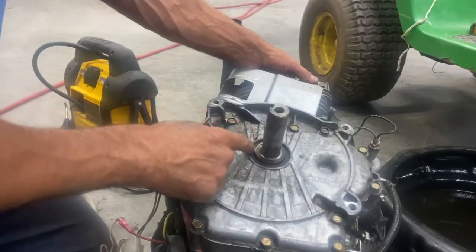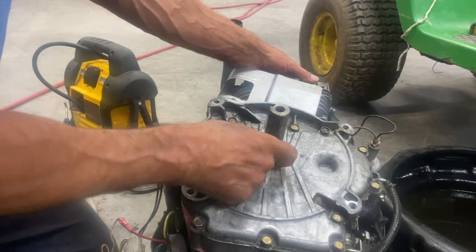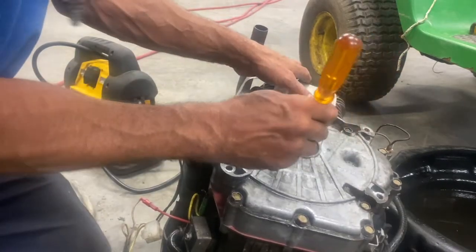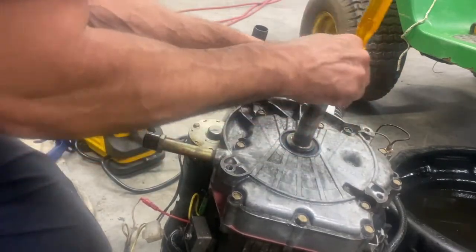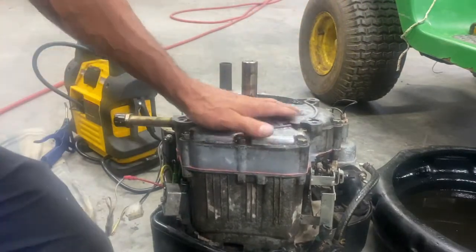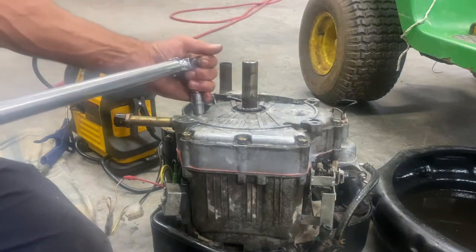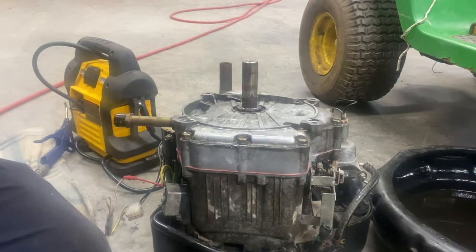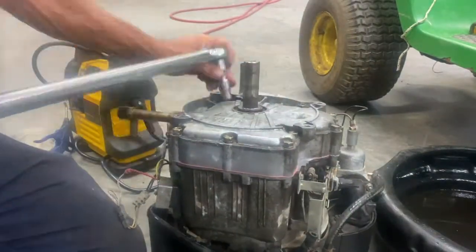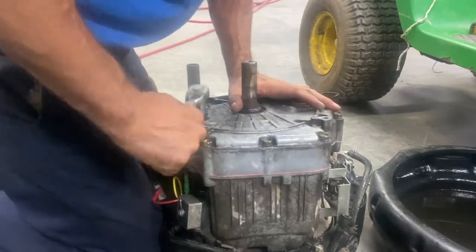When you put this plate in, make sure you don't roll this lip on the seal. If it hangs up and you press on the lip on the side like that, then you wiggle it in and push it in. Torque these to about 300 inch pounds, or 25 foot pounds. If you don't have a torque wrench, you can just guess — make sure everything is the same.